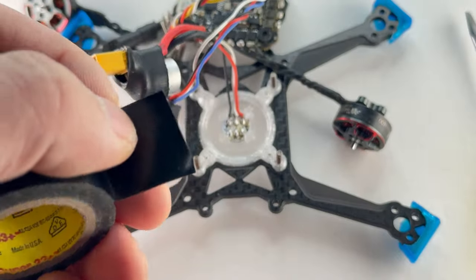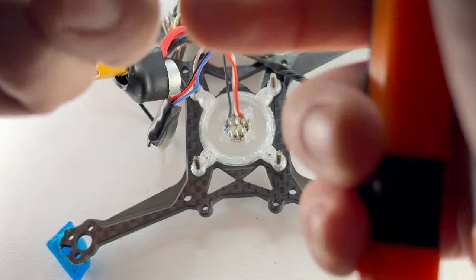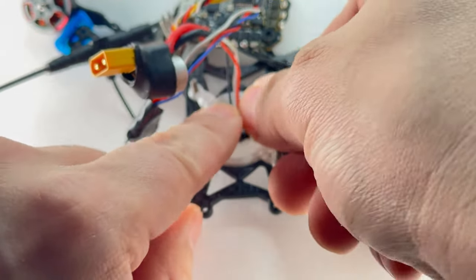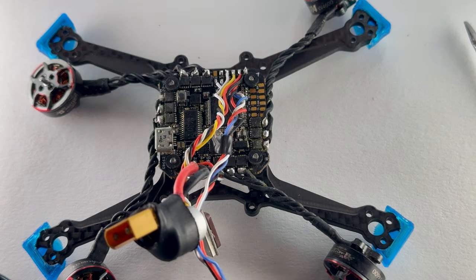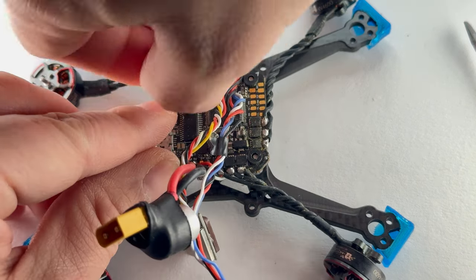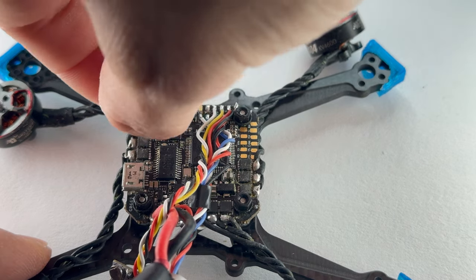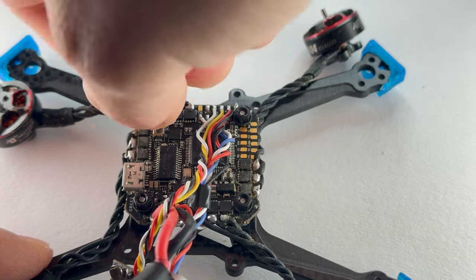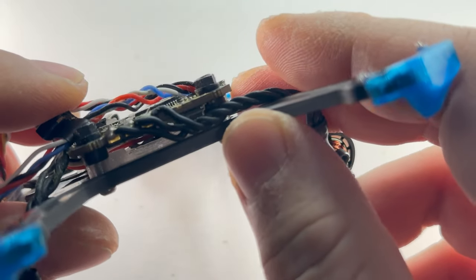As a precaution, just cut a small piece of electrical tape and cover up the LED so there's no chance it will touch your AIO if it somehow jumps out. Now we're going to secure the AIO with nylon M2 nuts — just go around all four corners until your fingers just start slipping. Double check that you have clearance to the LED light and it's not touching.